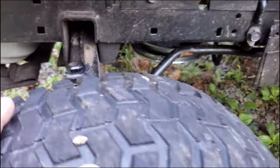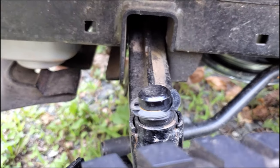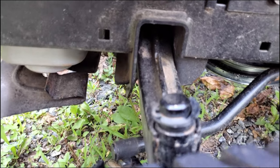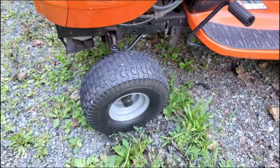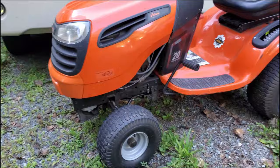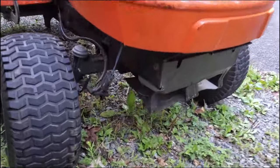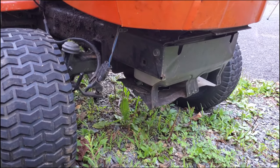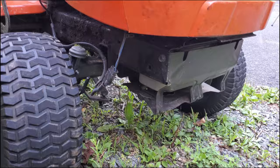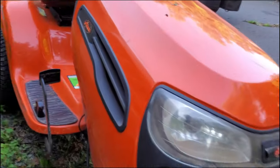That's not the ideal way — you have to figure out what changed. Looking in here, it sure looks like this axle is leaning backwards. You can maybe take a pipe wrench and try to twist it forward again and see what your alignment looks like. It looks like there are probably a couple things going on. They may have really run into something because the shield underneath the muffler is pretty mangled up and not attached to the frame anymore. It looks like the hood ran into something — maybe a car tire or a truck tire.